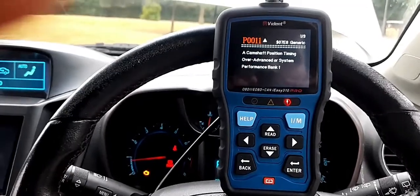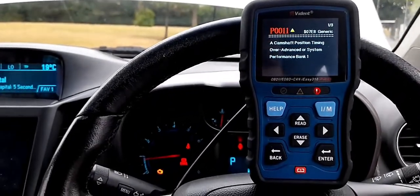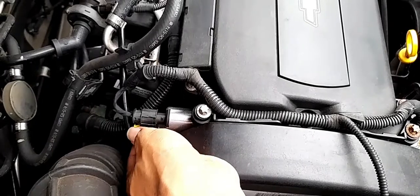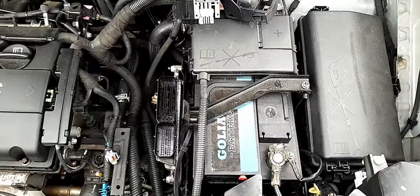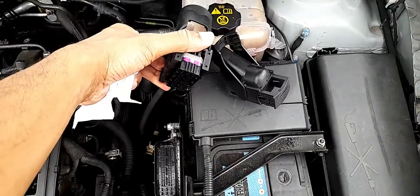This is relevant because my car is drinking a lot of fuel — at the moment I'm getting 17 miles per gallon. I've already changed this sensor; it's very easy to change, but it looks like it hasn't fixed the problem. It might be a problem somewhere else, but most likely it's going to be the ECU because I think there is corrosion.